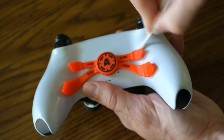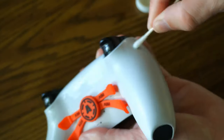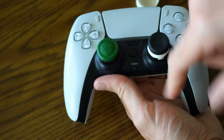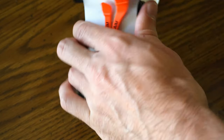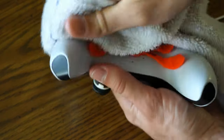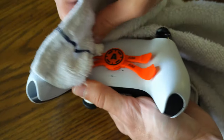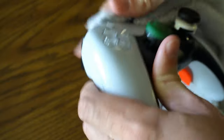Let's go on this side now and move up and down here. This is looking good. The only area I would really watch out for is the microphone and the speaker — if you're putting a lot of rubbing alcohol near those it may drip inside your controller, so just watch out for those areas. Here's the back — I'm just going to go along everything with my soap and water on my dish rag, wipe everything down, and then let the controller dry a little bit and it should be good to go. I can already tell it's looking a lot better after taking off the dead skin along the edges and on the back near my triggers.